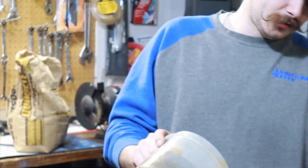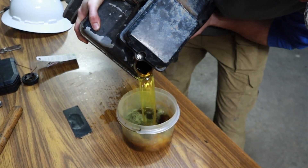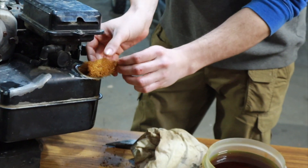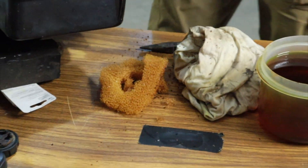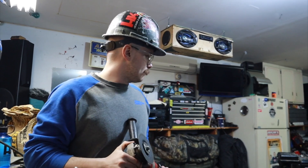Dumping the drained oil into the proper waste container, and now time to dump the old gas. There must be a fuel filter of some sort sitting in the gas tank — not a whole lot of strength to it, completely deteriorated. And this is just what I can grab; there's a ton more in there that's just broken down and clogged up.